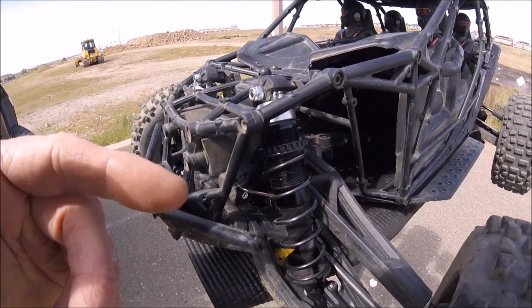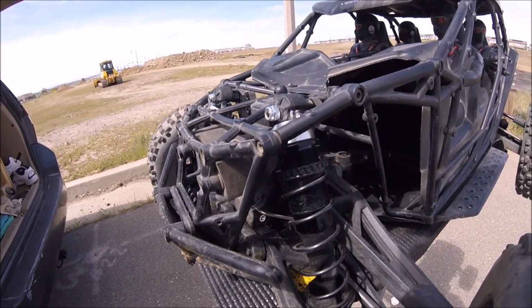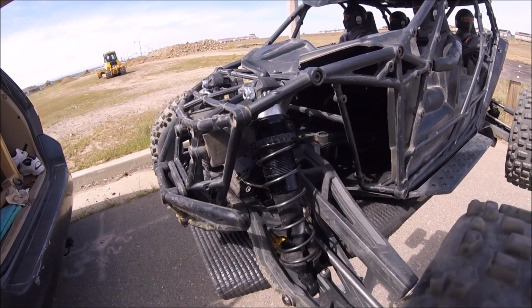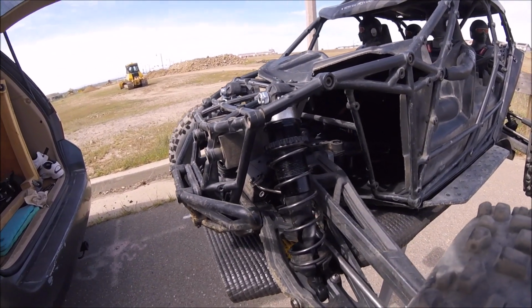And the biggest thing about this setup are the pistons. It's got a little O-ring around the side of the piston. As always, there's slits in the piston. You want to face those downwards. Essentially, the oil channels through there, puts a little pressure on the O-ring and slows the dampening. It basically gives you like a Cadillac ride and gets rid of that nasty afterbounce from big jumps.